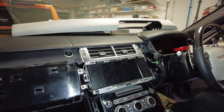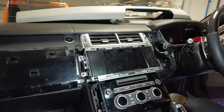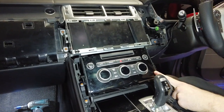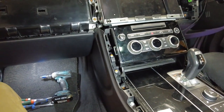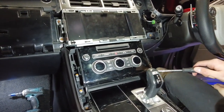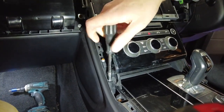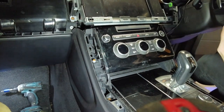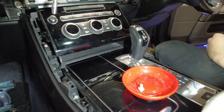What we've got to remove next is the heater fascia, because it's sat on top down there. It's no big deal. You've got your eight millimetre socket, Tyler — four screws. Do the ones this side because they're easy to see. Grab the little red pot, put it on there. We're replacing it so we're not worried if we're scratching.